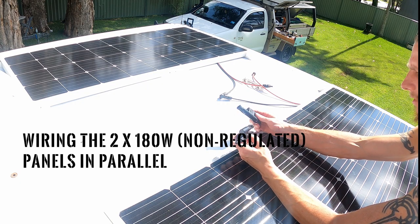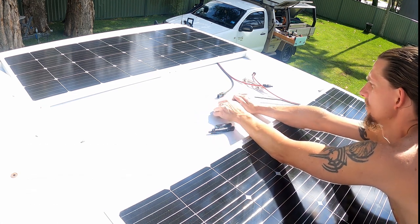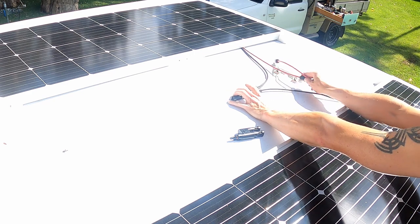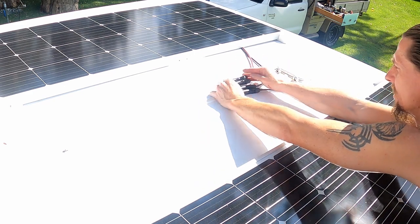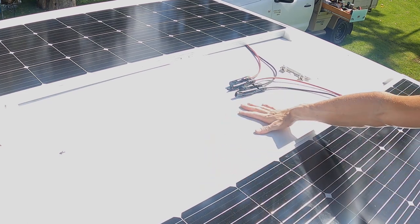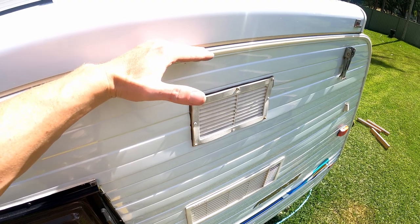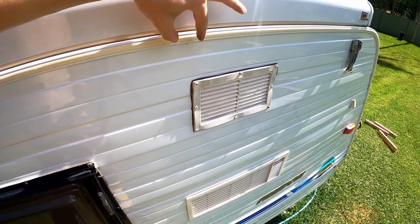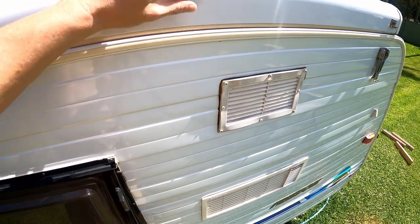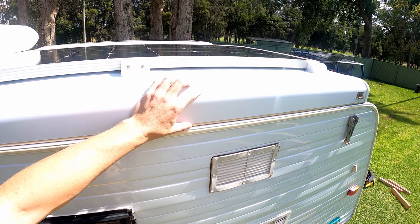To connect the cables up I have these wire junctions — basically connect both of the same polarity into one. These are both negatives. They're going to sit about there. I'm not entirely sure where I'm going to run down yet — I think I might run down here because this is where the pop top separates. I'm going to put an Anderson plug here and one here, and when the lid's down they'll connect. But when we pop the top, we have to release this one, the pop top goes up, and then there'll be a little joiner piece in between the two.